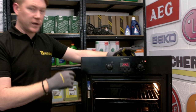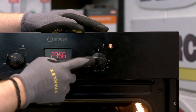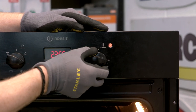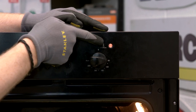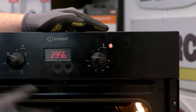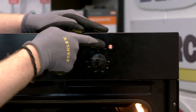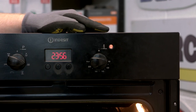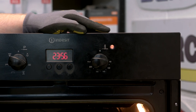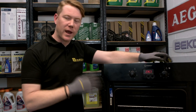Now, one thing before we go — just a word on the thermostat. The thermal cutout may have failed because the thermostat is stuck. So it's a good idea to turn your oven on to a low heat and then keep an eye on the indicator light. The indicator light shows that the element inside the oven is on, and this should turn off when the oven gets to the desired heat. If it doesn't and the oven is still heating up, it may mean that your thermostat has failed and it needs replacing too.